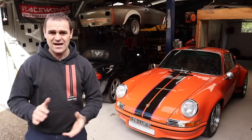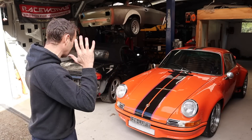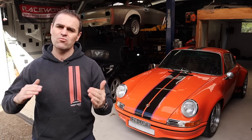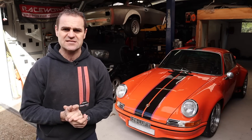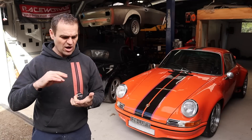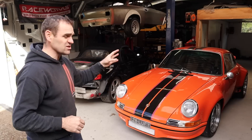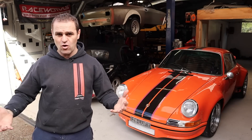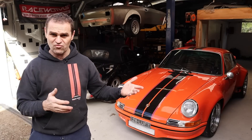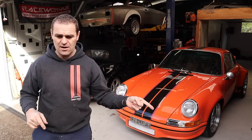Today we are back working on Harry. I'm going to put Rockstar on hold for a little while, just while we're sorting that out. Last you saw, I had a couple of issues on the dyno — the torque was dropping off sharply at 6,000 RPM. There were a few different ideas thrown around, and I thought it might have been low on spark, which we checked, and we know the spark system is all good. Both banks of coil packs are running well. I learned a lot from the comments — I didn't realize at the time that twin spark runs a lot less ignition advance than single spark does.